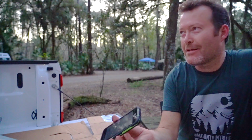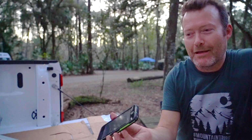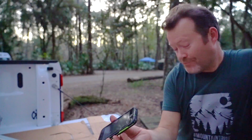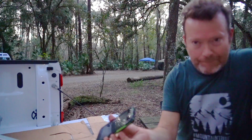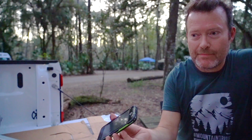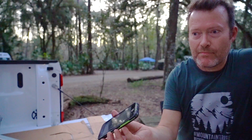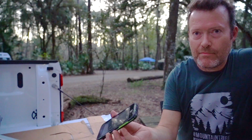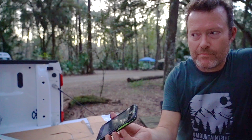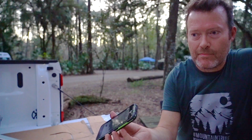So I was trying to cross every T I could. So I would say you did it right. The only difference is I don't think you need to put the chocks in place. Personally, what I would have done, and I probably would have left your landing gear so they're touching the ground just barely, and then fully engage your trailer brakes, and then just let your foot slowly off of the gas and see if it tugs and see what happens.